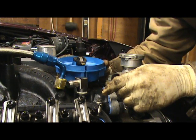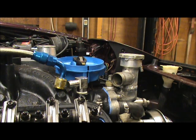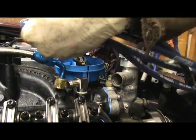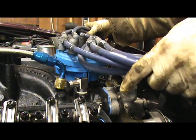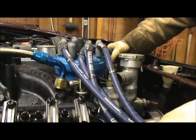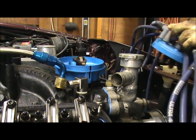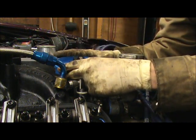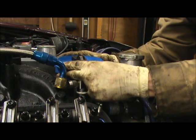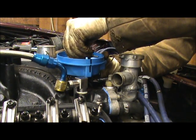Now, I think that might be really close, but I have to check it with my plug wires again to make sure that I have the plug wires laying the way I want them in the motor. Because you don't want it like this, you don't want it like that. It's gotta be even, laying right into the motor. I tell you what, laying like that, let's see how close I am. Boy, that's really close. Once again, I'm one tooth too far back. I just got to go one tooth ahead of that one, which sounds easy, but...